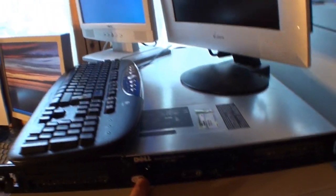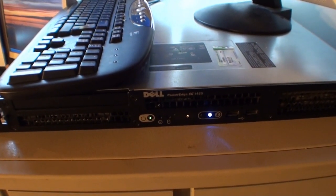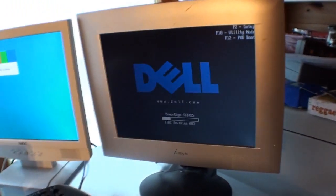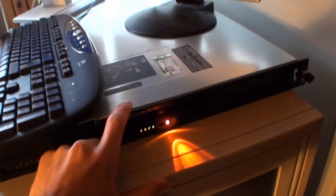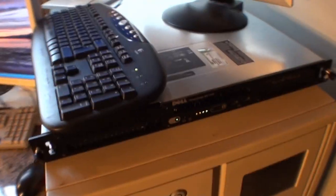As you can see, being a server, there's no CD-ROM or DVD drive. When I installed Ubuntu onto it, I had to take the lid off and use one of these spare drives on an IDE cable. I'll warn you — it's quite noisy. The fans speed up a lot when it first powers on, but when it loads they slow down. There's a blinking light because I've disabled chassis intrusion in the BIOS — if I just hit that button it goes blue to acknowledge the so-called problem.